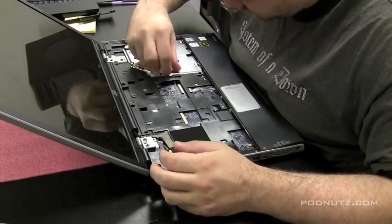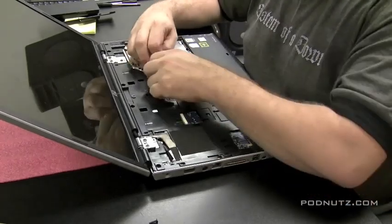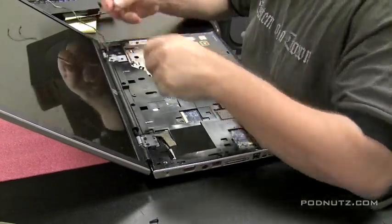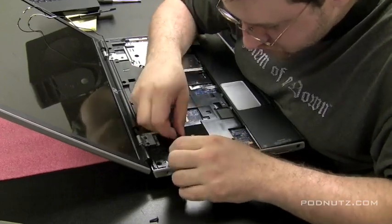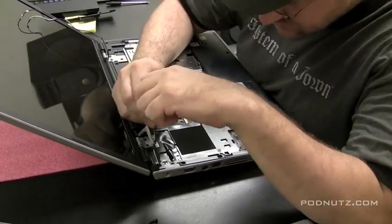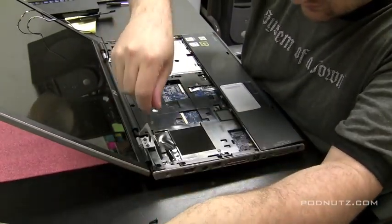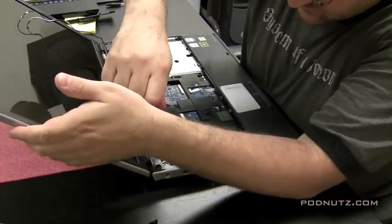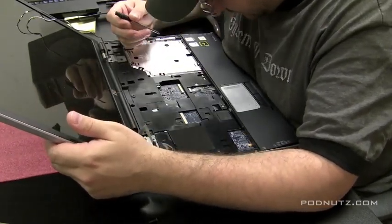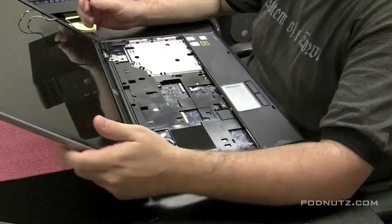It looks like we're going to have to take the whole computer apart here to get a real good look at the motherboard. Otherwise, it just wouldn't feel right about just slapping a new keyboard in, knowing that liquid leaked down into where the hard drive bay was. So right now I'm just pulling the wireless antenna through the bottom of the case to the top, and I'm going to detach the LCD cable. So these are the two wires coming out of the screen, and after we do that, we're able to pull the screen off. Once the screen comes off, we can get to the top and bottom case and get a good look at the motherboard. You'd be surprised when something spills in these things — the tiniest crevices the liquid could get into and cause a problem. The motherboard might look perfectly fine, but there's this one unexposed area, and once you expose that, you see that the liquid actually leaked in there.